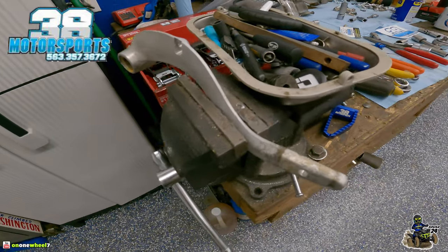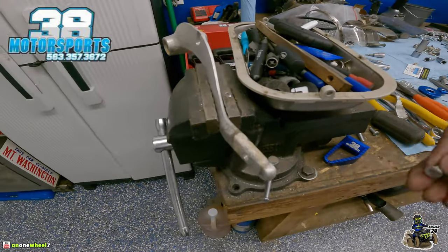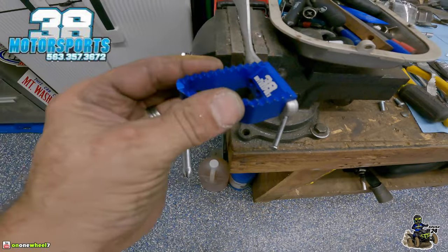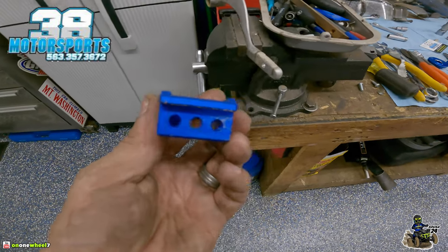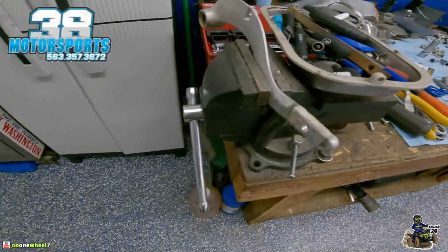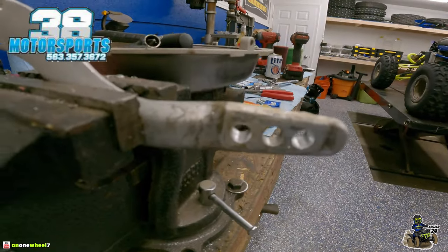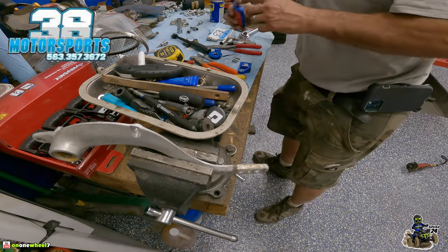We got the brake lever in the vise. We did grind off the old lever — I just cut it to expose the end of the rivet, ground down the end of it, and it popped right off. Check this out — that is sweet. You have options: you could put just one bolt in the middle, or drill two additional holes and put three. We're going to do the two additional bolts so this thing is secure and we don't lose it. We're going to red Loctite this as well. All our holes are drilled.